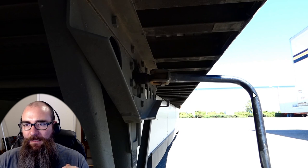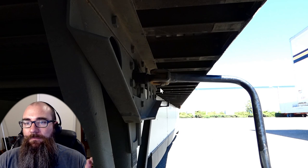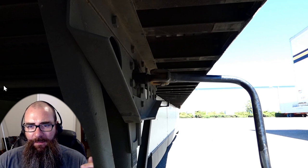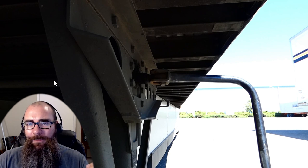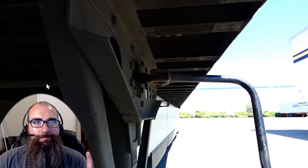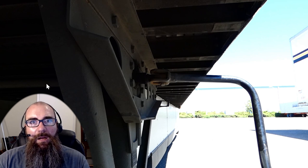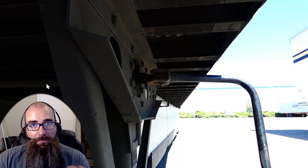This is a cranking landing handle, and every single one I've come across has two gears — the low gear and the high gear. In high gear, when you rotate this little handle, it will spin at the same rate. In low gear, it takes 10 rotations to equal one rotation in high gear. That's important because if you ever need to raise or lower the trailer because it's at the wrong height, you'll need to be in low gear. It'll make it easier, but it's going to take a long time.